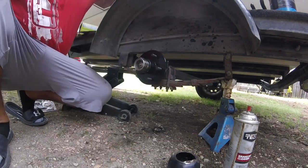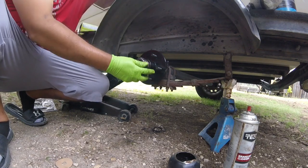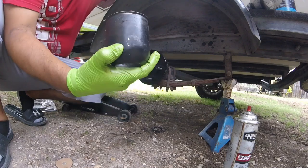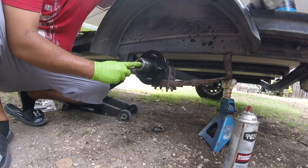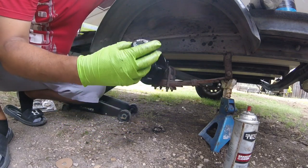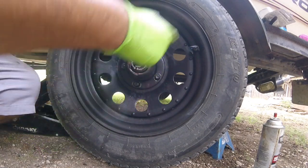My cap blew a hole when it got hot, so I'm just going to go ahead and put one of these bras on there — put it over it just like that. Then when I go back to put my wheel on I need to clean that out. I'll pack it with grease and a grease gun. I just wanted to show you guys how I plan on putting everything back together — put the Bearing Buddy bra over it. I kind of want it to match the other side. If not, I might just take that off.